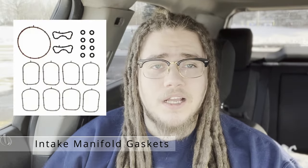If you're pulling the heads as well, here are the additional parts you'll need: 20 long head bolts or studs and 10 short head bolts or studs — ARP is highly recommended. You'll also need exhaust manifold/header bolts; the ARP header bolt kit is around $45. Head gaskets are of course required, and exhaust manifold gaskets — these can be reused but it's always recommended to go OEM, especially with headers, as many aftermarket gaskets can cause leaks down the line. You'll also need intake manifold gaskets; these can be reused but they often tear, so it's best to have a set handy.